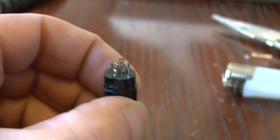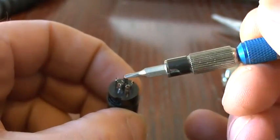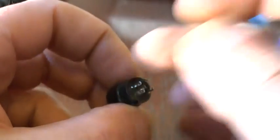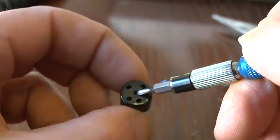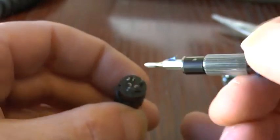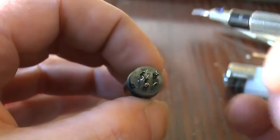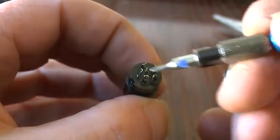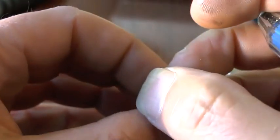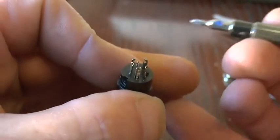Here's our nice new plug. There are certain pins on this you don't need — especially the middle one, pin 6. I've got what I consider to be a much better insurance policy than heat shrink or insulating tape. We're not going to use pin 6 — that's the pin of death — so we want it out of the way. All we're going to do is simply put a screwdriver on the back of the pin and push. Pin 6 is no longer there — danger gone.